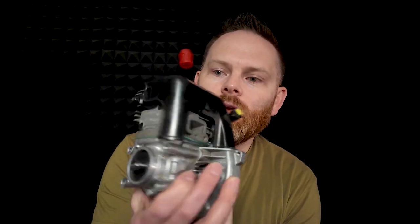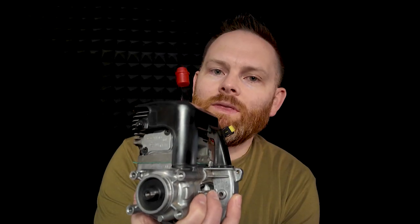Where these engines are very basic, I don't think there will be any kind of issue with that, so I have gone ahead and used that product — I did this all prior to that knowledge. For me, I will never reuse these transfer port covers, gaskets, or the cylinder when it comes time to replace them, so I'm viewing those as consumable products. If this was a much more expensive engine I would remove any of this sealant. Just note that I do suggest using a silicone sealant on the transfer port covers — find one that is compatible for use with copper alloy as well as gasoline and oil.